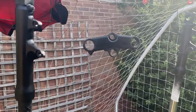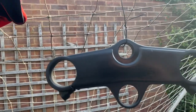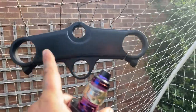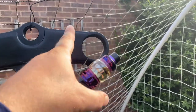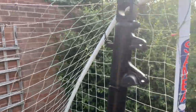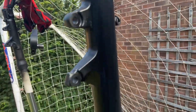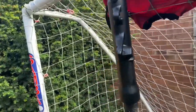I'm so impressed with the finish on the top yoke that I've decided to do the forks in the same matte black. The only thing that was a bit of a mistake — I tried to rub it down — that's a no-no. The matte paint without the lacquer on it just peels off. So what I'm going to do is lacquer it. I was going to stick a sticker on the top anyway — I've got a chrome sort of top part to put on — but the forks have come out quite nice. They definitely need lacquering if you use that matte paint, it just scrapes straight off.